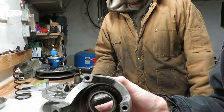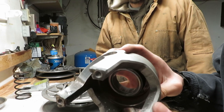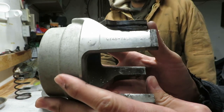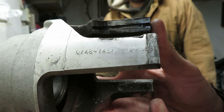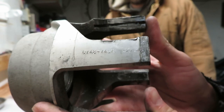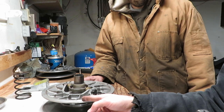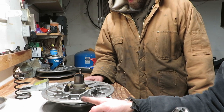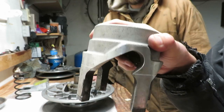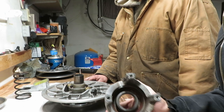So that's going to be what came on my sled - that's the original. These helix angles are specific to the power going through the drivetrain. I think this came off a 9000, which should be the same motor that I have, just turboed. So I guess that would make sense that it's a power difference thing. This is the one off of my sled - we're keeping that because of the measurements and angles. That'll be specific to my sled but the rest of it is more or less universal.